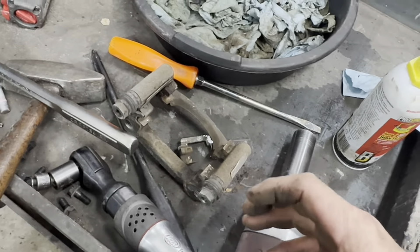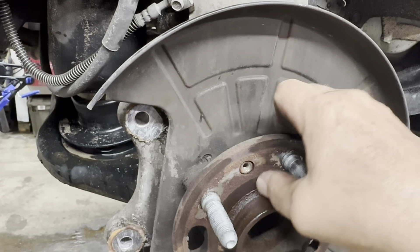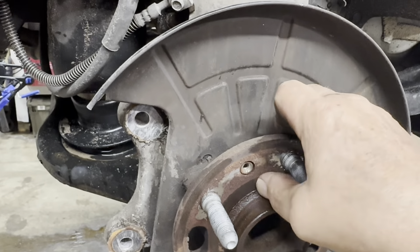You can see how nasty the rotor is on the inside. Same thing on the hub bearing — you've got to clean this up as best you can. This is a stepped hub, which should be lower on the inside than on the outer edge. Clean it all up, get it nice and shiny. Try not to remove any metal — if it's too pitted and flaking off in chunks, you'll need to replace it. Most of the time I replace them.